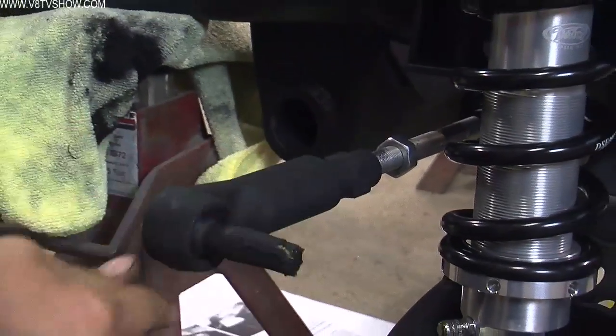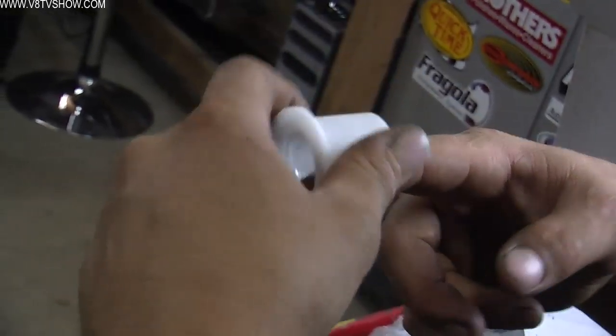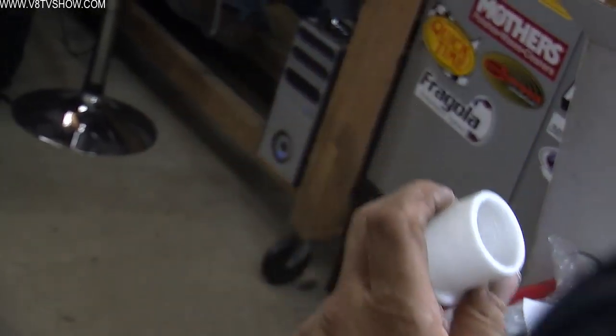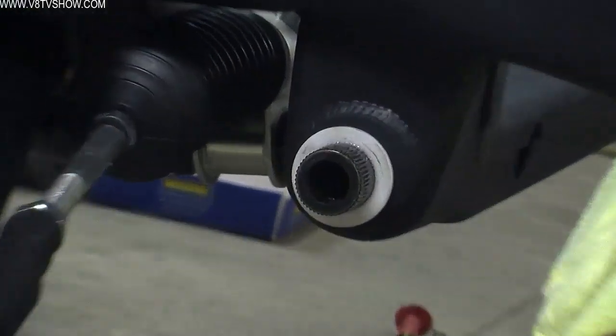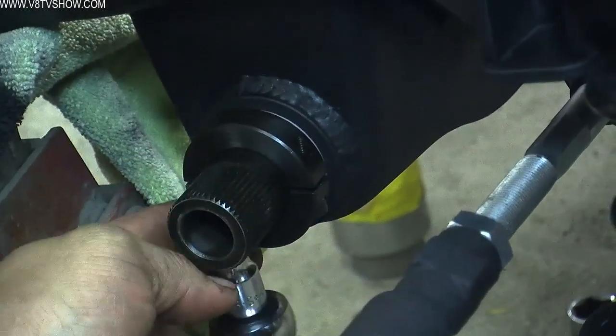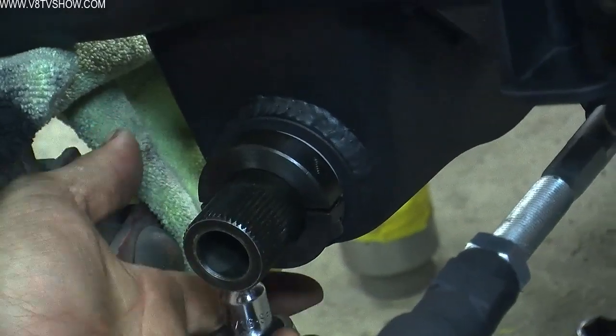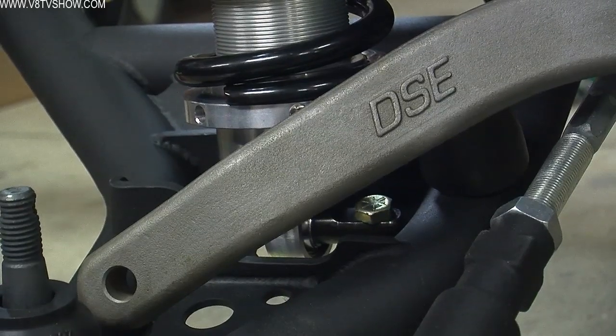The other hard part is the sway bar. Installing it is kind of a challenge because you have to hammer in these press-fit bushings, and you have to go back and forth from side to side, because if you hammer one side all the way in, you push the other side of the sway bar out. It's a little challenge balancing how many times you hit each one to get the sway bar in. The sway bar arms are also a little difficult because they've got a spline system on them, so getting them on the right tooth of the splines, the same on both sides, takes a couple of tries.